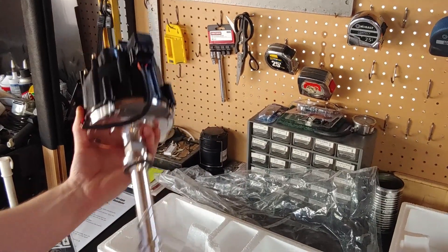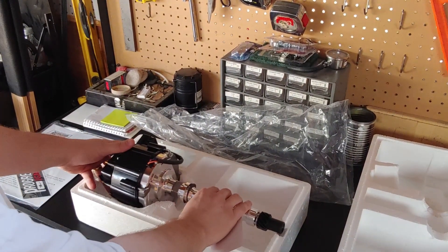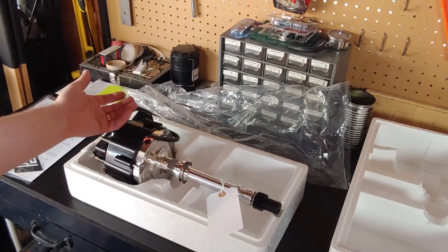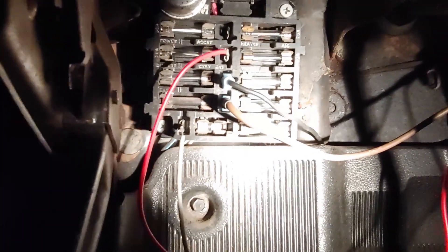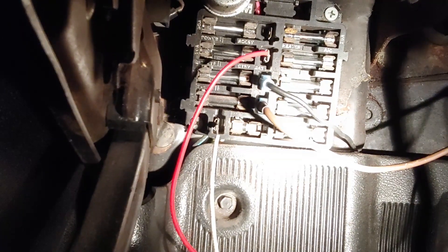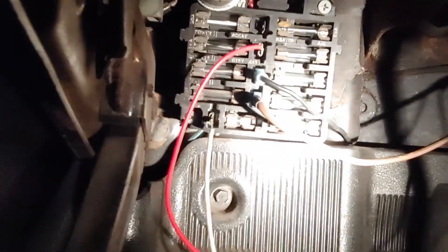That's the unboxing. Now I'm going to show you guys how to run the wire, because you literally just need the one battery wire. Let's step over to the car. Now we're back at the car. I'm going to show you guys the fuse box. You've got three wires — the top one is battery, the second is accessory, and the bottom one is ignition. I just put that in — that's for the distributor, the bottom wire.